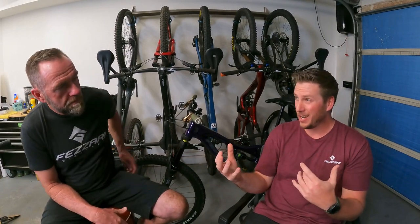We dropped everything down. And so spring rate, so the amount of air you're putting in the air shock or the weight of the coil to match where you need to be at sag, has come down about 20% from where we were previously. Nice. So me, I'm big. I used to be running like 300 PSI in a shock. You know, I'm down at like 260 now.